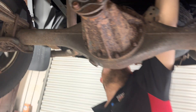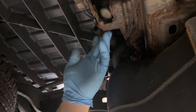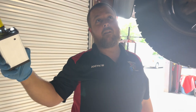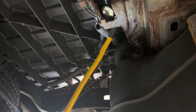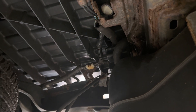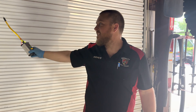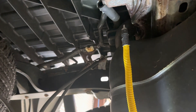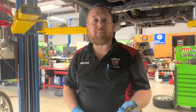One way I like to test vent valves is to come back here and pull the vent valve hosing off of the vent valve. If you remember a second ago, we sniffed this area and had no leak — the vent valve is closed at this moment. Or is it? Testing one more time on the outlet of the vent valve — it picks up every time. We've got a vent valve on this vehicle that's not closing completely.